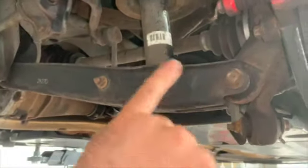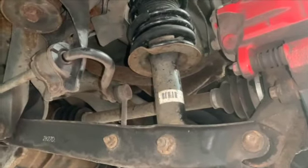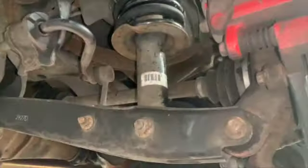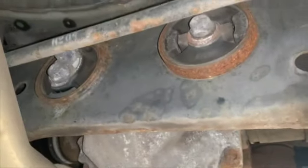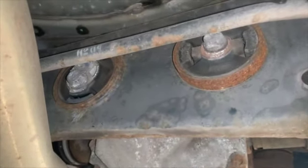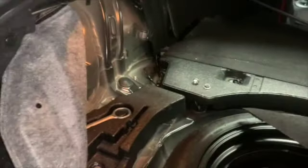Rear wheels are off. To gain access, you remove this bolt, this bolt, and go inside the boot — it's another two 12mms — and we'll have the shock out on both sides. Nice and easy. Lube them all up and everything will work nicely. Then we're going to move on to the diff bushes. So trims out, and it's two 14mms on that side and on that side, and then it's yeehaw the shocks out.